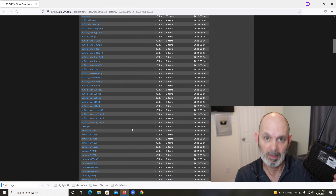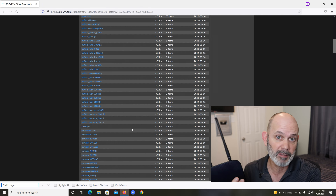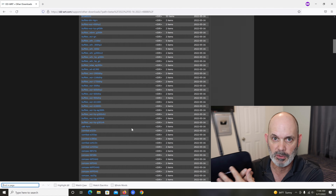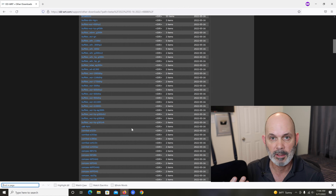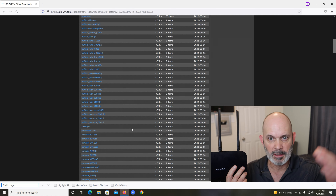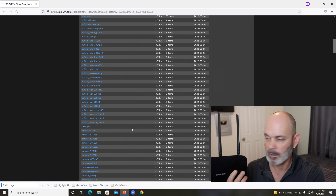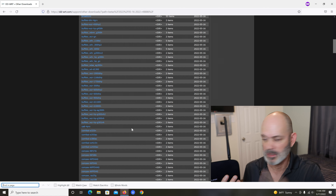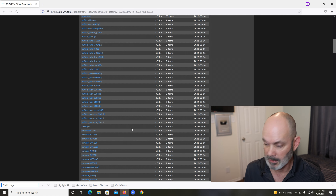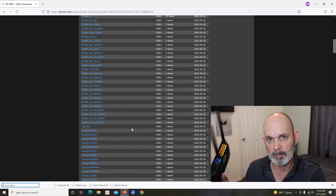These are crucial — if you get the wrong version or wrong model number firmware and put it into your router, you're most likely going to have to watch another video on how to unbrick it. Be very, very careful on which firmware you choose. This is a WR940N version 3. If your router is on this list you'll be able to use DD-WRT and get all five ports working. If it's not on the list, watch my other video — you'll still have four LAN ports working as a switch.